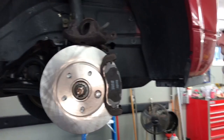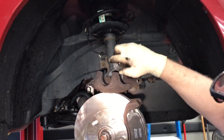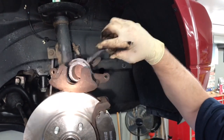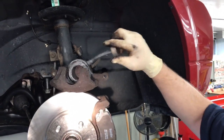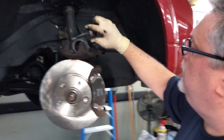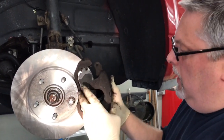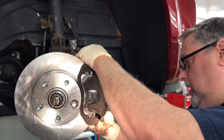We're going to take a little bit of never-seize and put it on the inside where it touches the brake pads, and also on the piston to keep the boot from dry rotting — that'll help prevent that. When the piston touches the brake pad material there won't be any squeak. Make sure the hose doesn't have a kink in it, slide the caliper on, hold your boot in, and get the other boot seated.